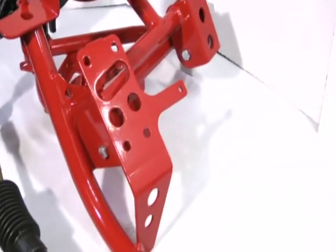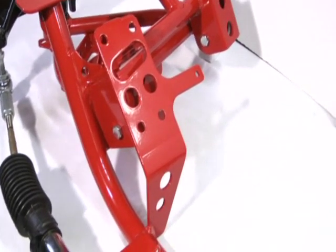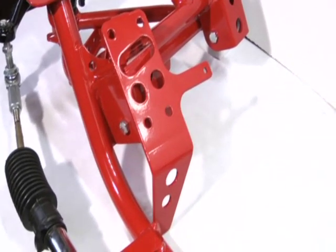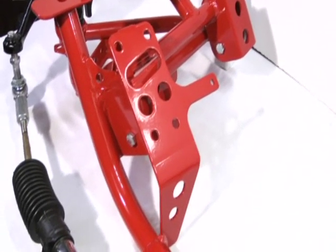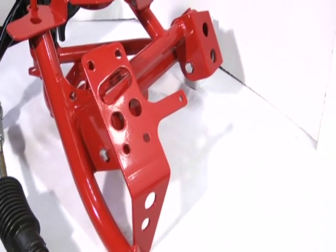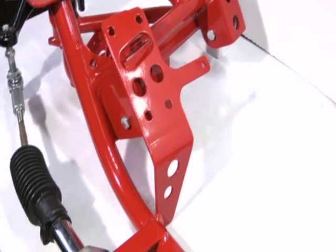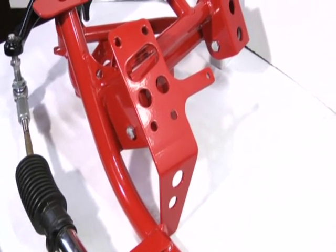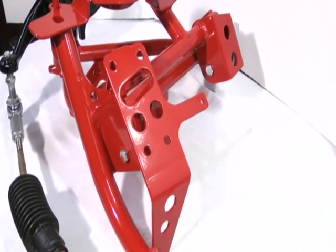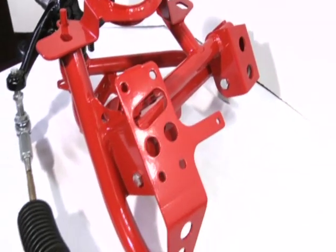One other thing I wanted to go over on this tour is the motor mount pads. That's what you're looking at here. This one in particular will mount a small block Chevy, big block Chevy, or an LT1. We also have versions available for an LSX swap and for the 3.8 liter V6, which would be the V6 like it was in a turbo Trans Am. If you are using block mounted motor mounts, whether it's rubber bushings, poly bushings, or solid motor mounts, you need the motor mount pads. That is what the block mounted motor mount bolts to on the K-member. These 4 holes, that's where your motor mount bolts to.